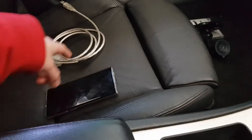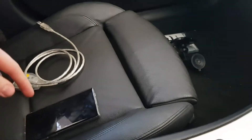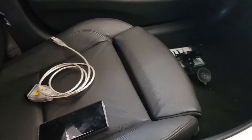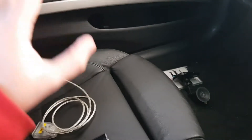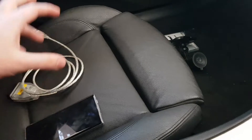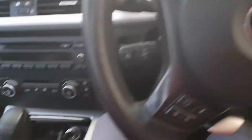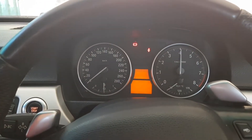What you'll need is the OTG cable, a device with MSD, and the back-end flash maps. You have to download it from N54 Tech — I'll leave a link in the description. Click on the latest link because there are three links and the top one is the newest one with the newest software. Download it, unpack the zip file, download it onto the device, find it in your MSD. Right now I'm on map 5, so you just go to map 0.